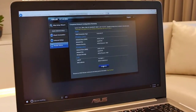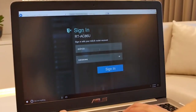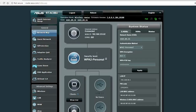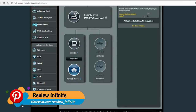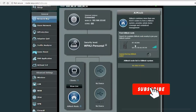Complete setting up our access to the internet. Once the internet is up and running, let's upgrade the RT-AC86U firmware using the same process. Once confirmed, the AI Mesh icon will appear. Activate AI Mesh, select the RT-AC68U as the extending node, and click Apply.